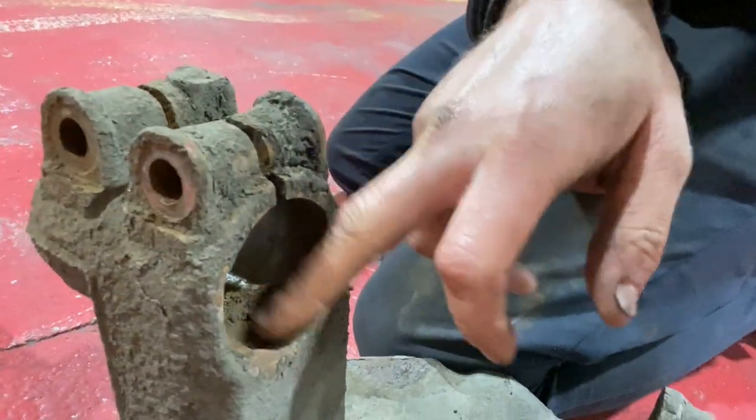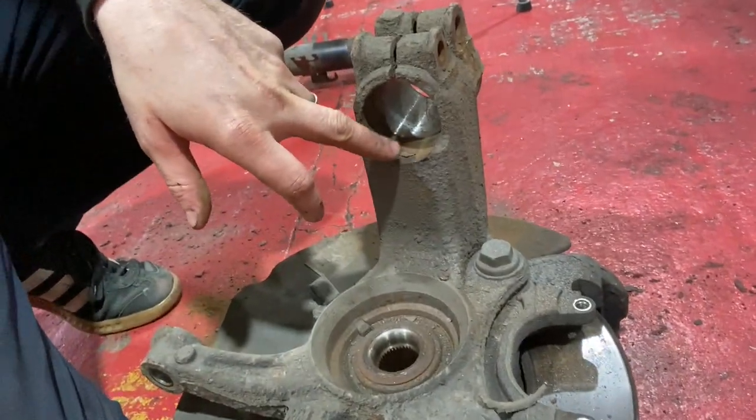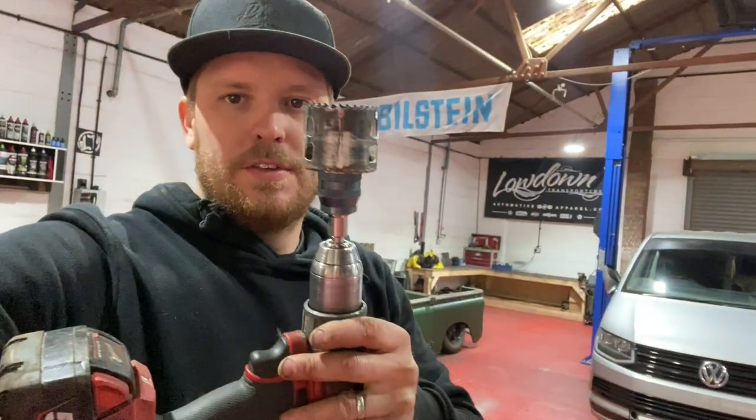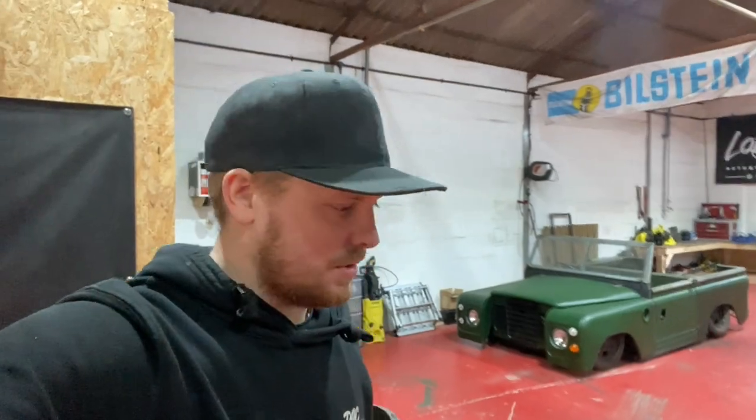This is a T26, T28, and T30 style where the strut slides in — the T32 is different, that just clamps on in a different way and doesn't actually go into a sleeve. You want to use something like a hub splitter — put that in there, turn it, and it opens that slit so you can get the shock out. Or you just knock a chisel in — it'll open it up and the strut will slide out. Now, if you look in here there's a lip at the bottom. We want to take that off — that's the hub mod which we covered in the first T5 series on the channel. It allows the strut to go further through the hub, effectively lowering the vehicle a few more millimetres. I've gone through and cut with a 57mm hole saw on a drill, then gone back in with a die grinder and a rasp to take the rest of the lip off so the strut slides all the way through.